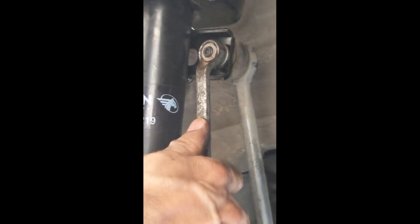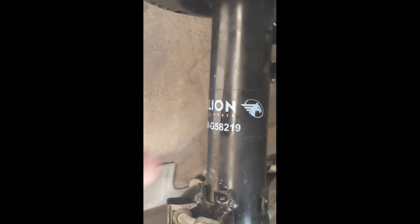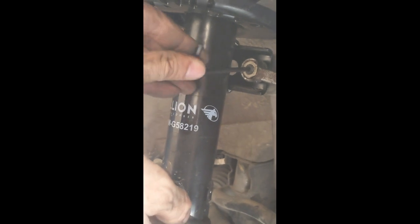This is the link rod that we will be removing. It has a 16mm bolt. You just need to put this in and anti-clockwise it will open. In case it doesn't open and it rotates along with this, you just need a hex key — 4mm. You put that in between there and you can then remove this nut.